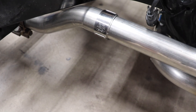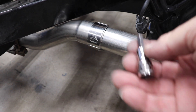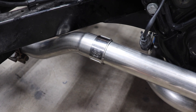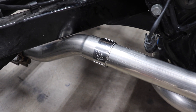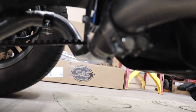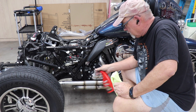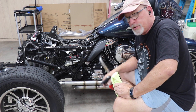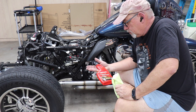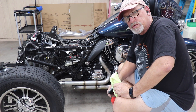When putting the clamps on, it's actually a metric Allen wrench you use — a 6-millimeter. It looks a lot like a quarter-inch American but use metric 6-millimeter. With all the clamps tightened, go underneath and tighten that one up too. Before putting the chrome pieces on the pipes, clean the header and everything — the crossover and all other pipes — because grease and oil from your hands will burn and discolor.